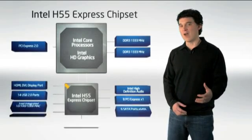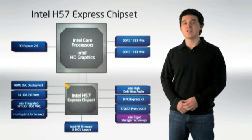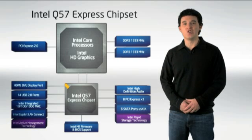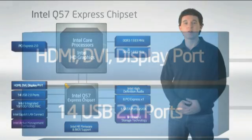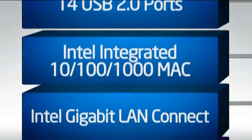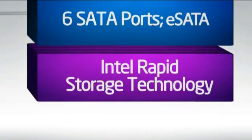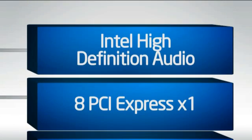This is even more so the case with Clarkdale because now we have the graphics getting integrated into the CPU package itself. The graphics is an evolved form of what we had in the G45 chipsets from the Core 2 generation, except we have more display connectivity — it supports dual HDMI output simultaneously. It runs at higher clock rates because we've gone from 65 nanometer manufacturing to 45 nanometer, freeing up some thermal headroom. And we also have a protected audio video path.